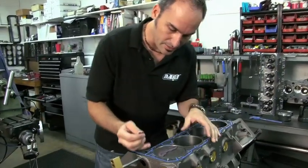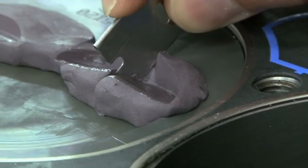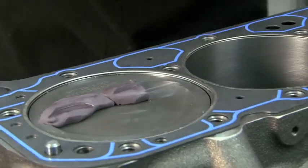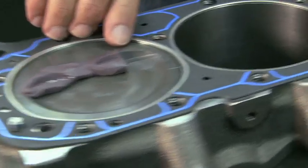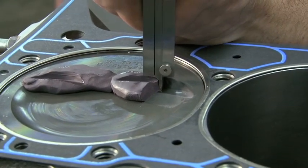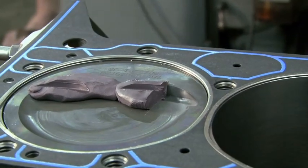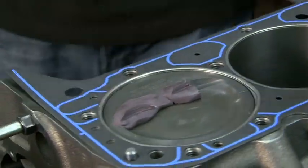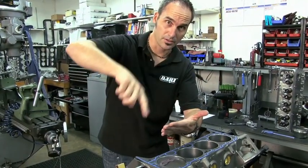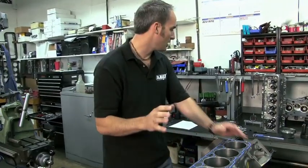Now to complete the CSI here, I can slice right through carefully and peel this away. You can see right there on the side — I can start coming in here with my calipers and measure what I've got for clearance there and make sure that I'm good. I got plenty here. So you've got the two faces: the valve comes down and you've got the pocket face, but you've also got radial clearance around the outside edge. So that's something you really want to pay attention to, and that's what the clay is going to let you do.